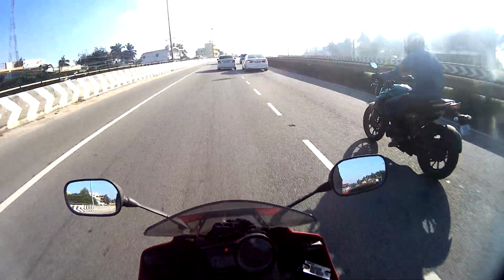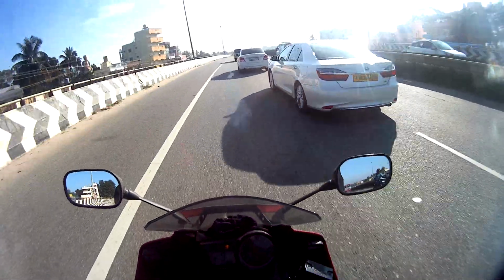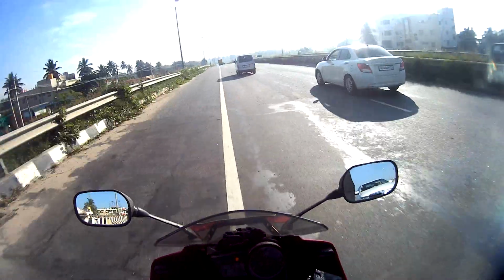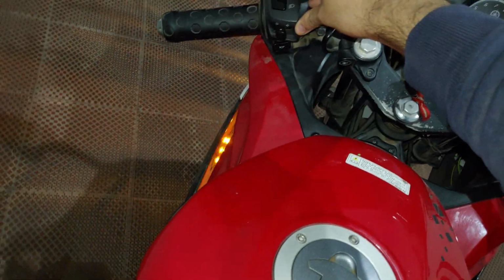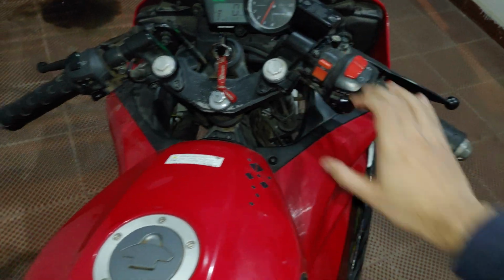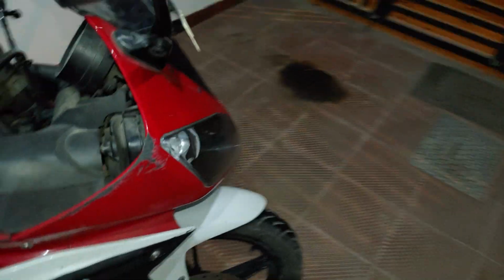Or you can go the DIY route, which is a bit more involved, where you have to connect the indicator switch from both indicators, either at the front or at the rear, and connect them through a fuse and go through the switch. When you flip on the switch, both the indicators get power, so all of the indicators will flash because of this. Now the thing is, activating this is a bit more of an involved process, because when the switch is off, your indicators will work normally.